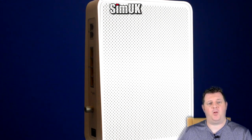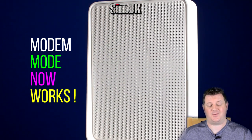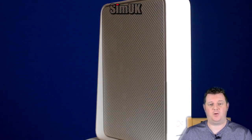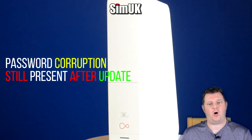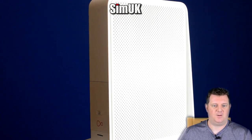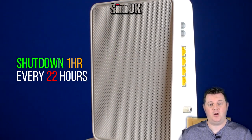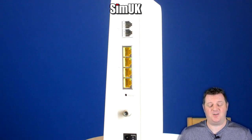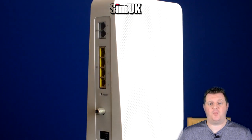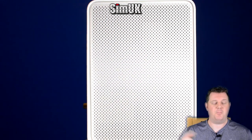The key fix for me meant that I could finally put the Hub 3 into modem mode and it wouldn't switch off every 25 minutes. I bought a brilliant Asus router and jammed the Hub 3 into modem mode and haven't looked back. It did take a few attempts though, as the password corruption issue was still present, requiring numerous hard resets just to gain access. Finally it had to be configured remotely by customer services in India who, after two hours, managed it but suggested overheating was the cause and that the Hub 3 should be shut down for one hour every 22 hours of use. I recommend Asus routers highly — even the dated models are very good.